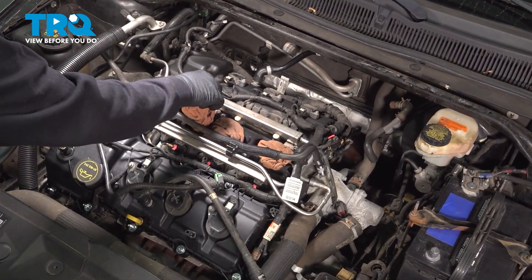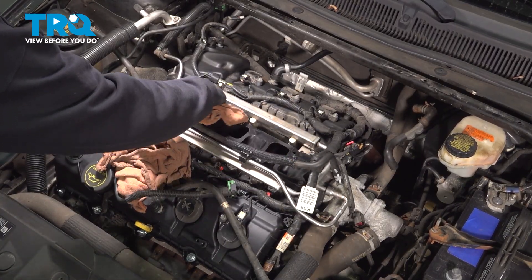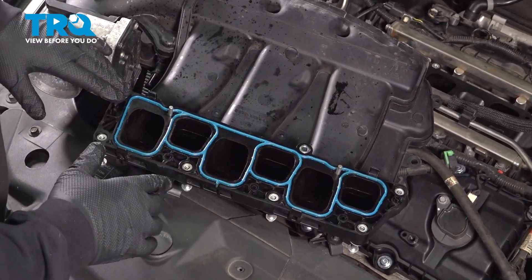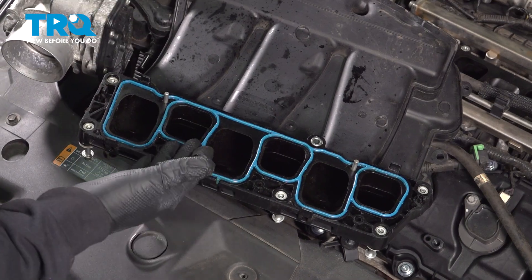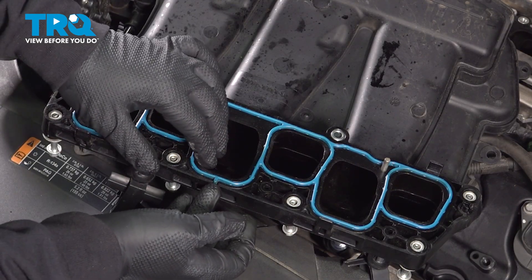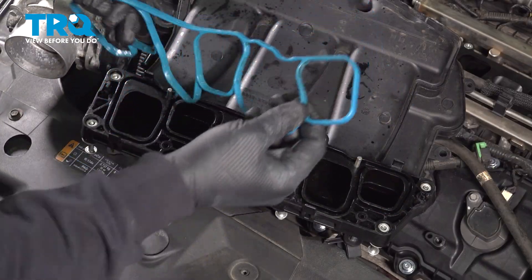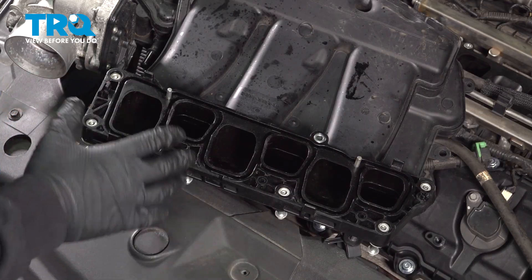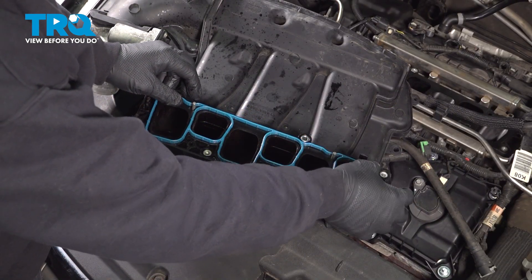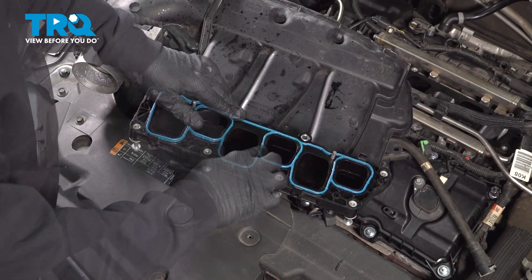Now remove our rags from our lower intake and make sure that lower intake surface is clean — we already previously cleaned it, so just give it a quick wipe. With your intake flipped over, focus on the gasket itself — shown here in blue. These gaskets are reusable for several removals and installations. Make sure the gasket, when you run your finger over it, sits higher than the plastic of the intake. Go ahead and pop out that gasket and clean inside the grooves using some spray solvent. If you need to replace the gasket, remove it and install the new one — this is critical; you don't want an intake vacuum leak. Line it up, press it in — it secures itself and you don't need any RTV.